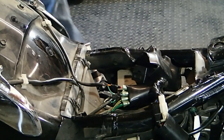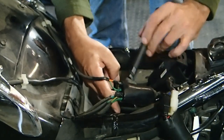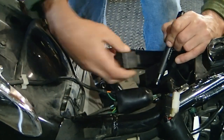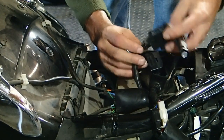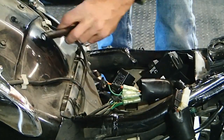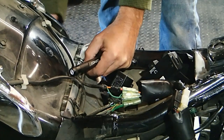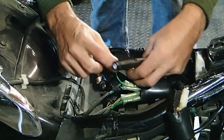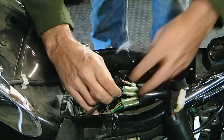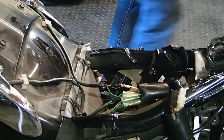The relay looks to be right here, under this bundle of wire. That's your relay for the blinkers and flashers. If you follow the wires, they go into the turn signals — these two right here, one goes all the way back. And it looks like somebody spliced into them at some point. I don't know why, but let's get the meter out and check it and see if that's our problem.